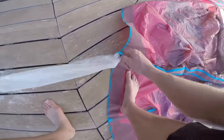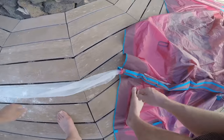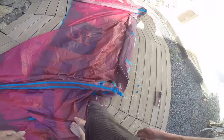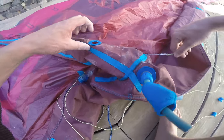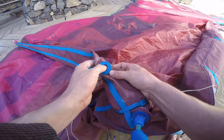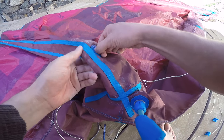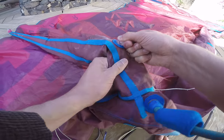Once you've done that, feed the end in, make sure the string is tight and everything's in the right position. Then feed the strut valve up into the bottom end of the strut itself, and take care when pulling it all the way back up through until you can see the white bit of string — that you originally tied the line to — coming out of the hole in the bottom of the strut. That's how you know the bladder is in the right place. Once it's in the right place, put your finger into the valve hole, find the bladder valve, make sure there are no bits of bladder in the way, and bring it back up through the hole in the strut.